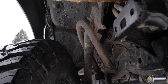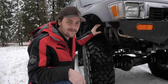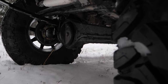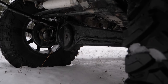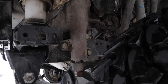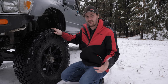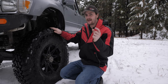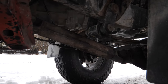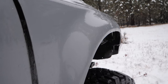For shocks up front I've got the Bilstein 5100s — these are the 10-inch ones, which are slightly shorter than the ones that came with the Trail Gear IFS eliminator kit, to accommodate the lower ride height. I'm also running Trail Gear springs with the bottom leaf removed just to get it that hair lower. My steering box has also been moved to accommodate the total lowering of the truck, and it also fixes the binding of the steering links I had under extreme flex. Powering the front end from the transfer case is a square tube driveshaft. These are high-clearance fiberglass fenders from toyotafiberglass.com.